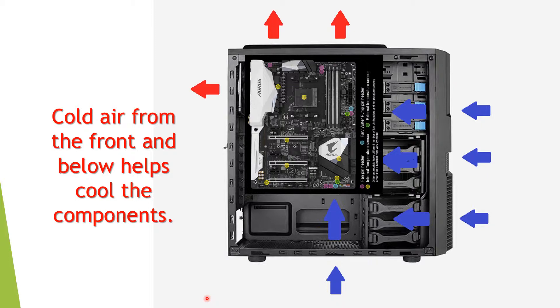This is a picture of a case and it shows the direction of the airflow. When you position your fans at the front and the back, it dictates how the air movement is going to happen. In my case, I've gone for air intake at the front with 240 millimeter fans, and air extraction at the back — this fan came with the case and it's 120 millimeter.